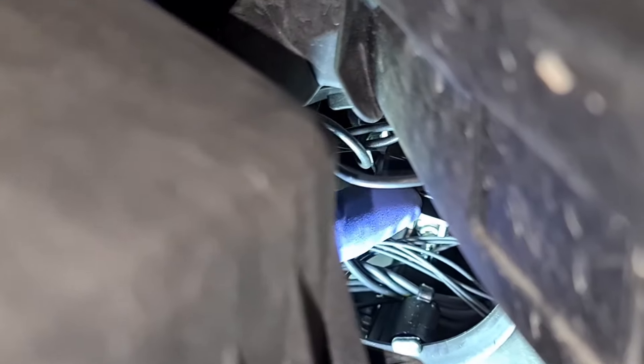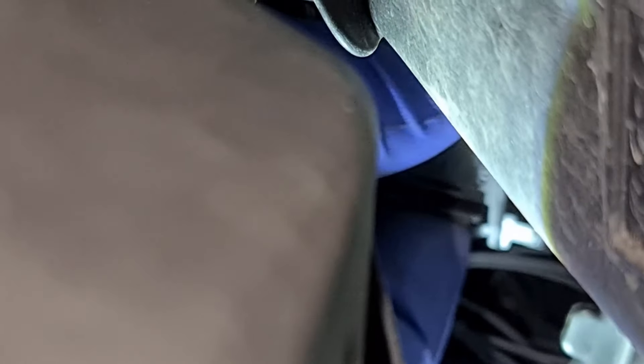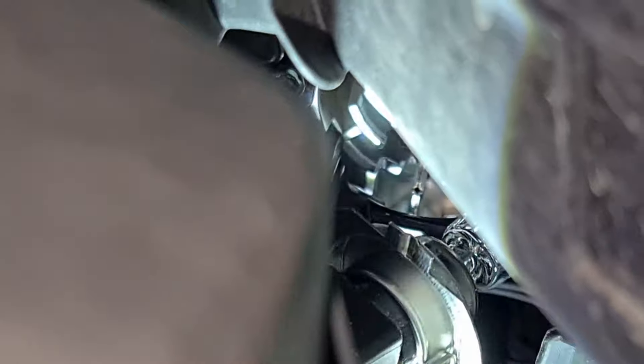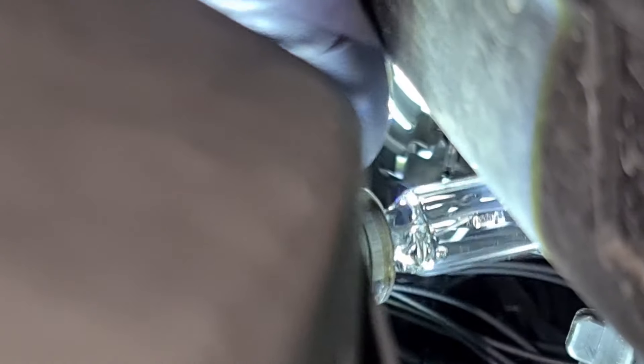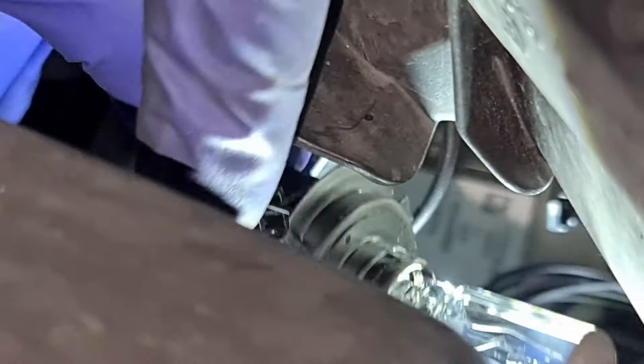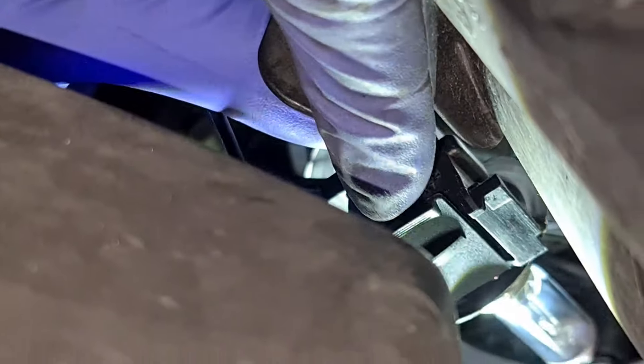I'm going to show you on this side here. This is the cover I just removed. On the inside you can see that plug right there. All I have to do is push the pin clip up and then take the whole thing out. Just remember how you take it out and the pin locator for the H7 bulb, and remember these bits either side and how they go. You can see that bit right there — they've got gaps in it, just right here and there.